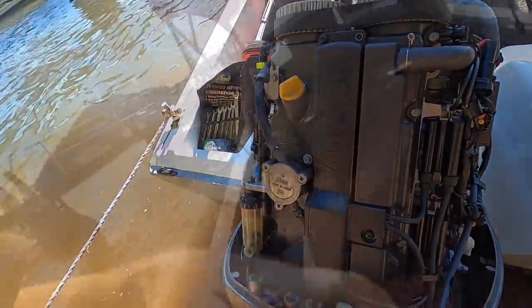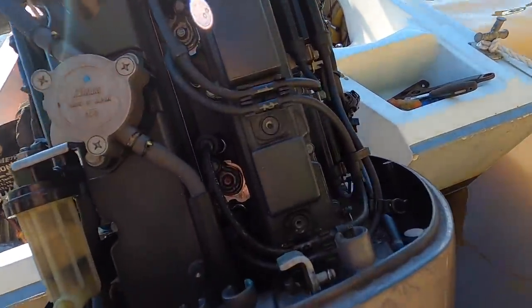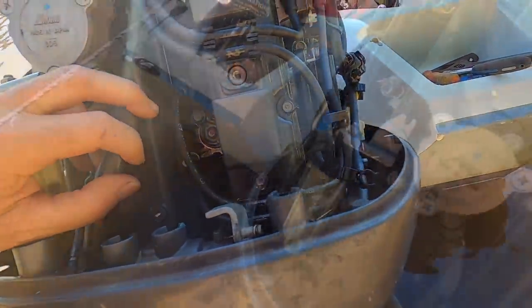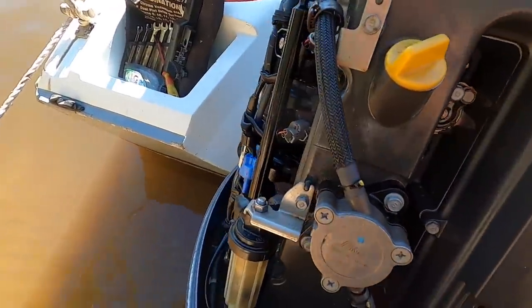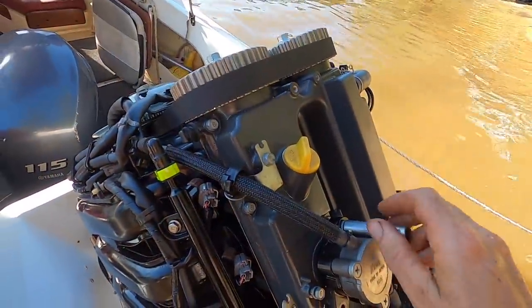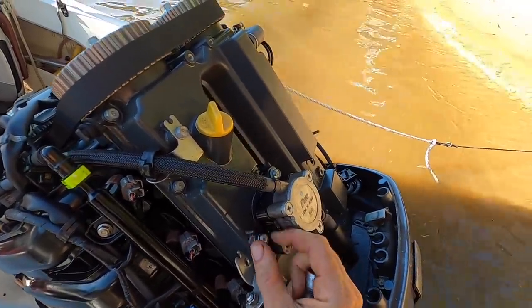You can see here how emulsified the oil is. A few Phillips heads to get the cover off here. Spark plugs. Always good to have a record of how things go back together, particularly if you don't have the service manual. Okay, inlet fuel filter. Fuel pump run off the cam presumably, over to a VST here. So let's just get the fuel filter and the fuel pump out of the way. A little retainer here for the fuel hose as well. I'm just putting all the bolts back in where they came from.